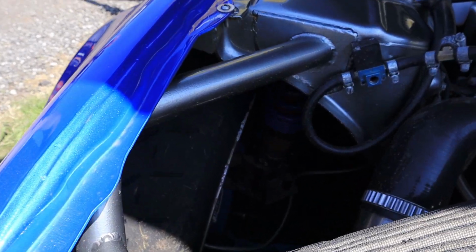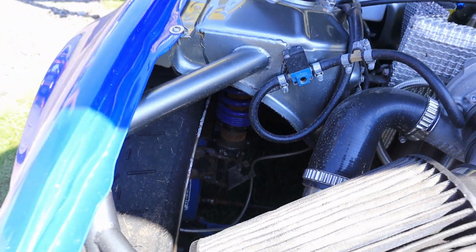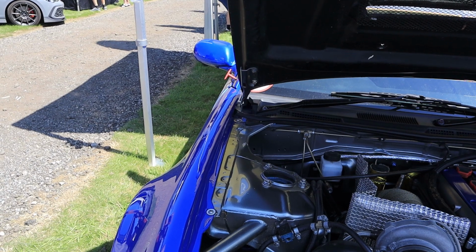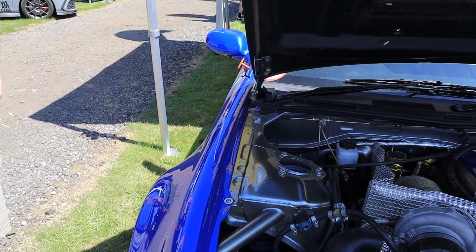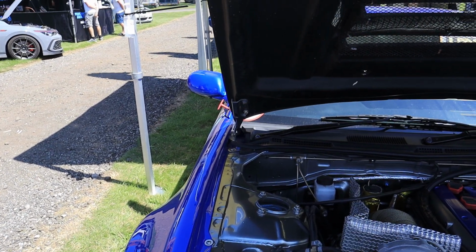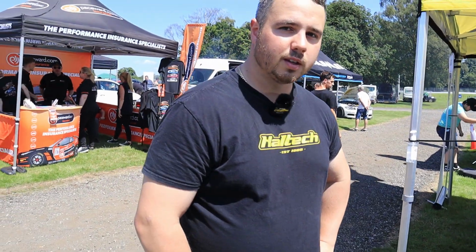Hence the camber. And then there have been so many schools of thought over the years as to what to do with other alignment things like toe, for example, which has been an interesting one because people used to run a little bit of toe out to try and help open there, and then it started to go to a more neutral setup with minimal Ackermann as well. I mean, what's your take on that these days? So I used to run cut knuckles, and I also run a Driftworks drop knuckle.